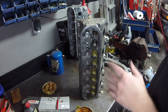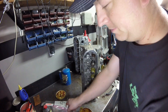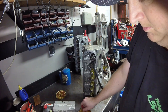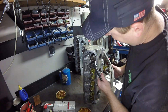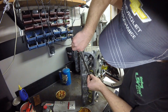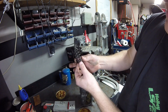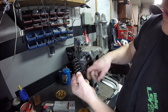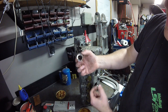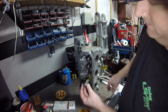This would be a good time to replace your valve seals if you're going to do that, but this is a low mileage head. Now I've just got to do all the rest of them. These are beehive valve springs so they're a progressive rate spring — you can see that at the very top they're smaller diameter than the bottom. So make sure the smaller end goes up so the retainer can fit on it correctly.